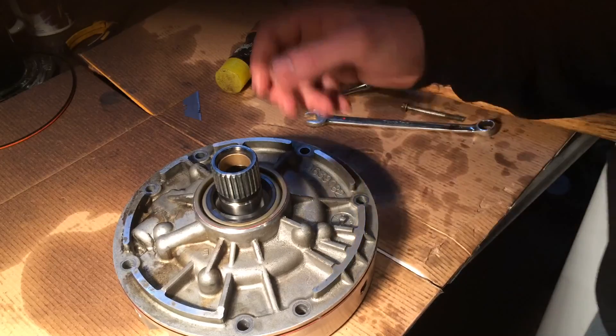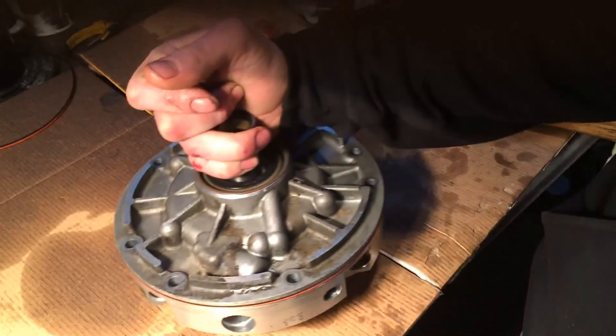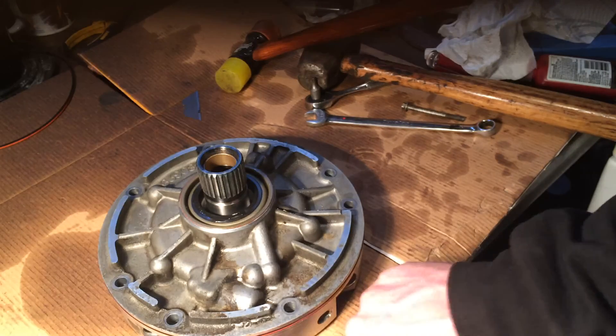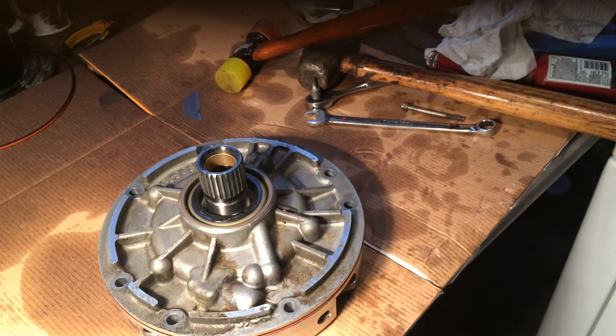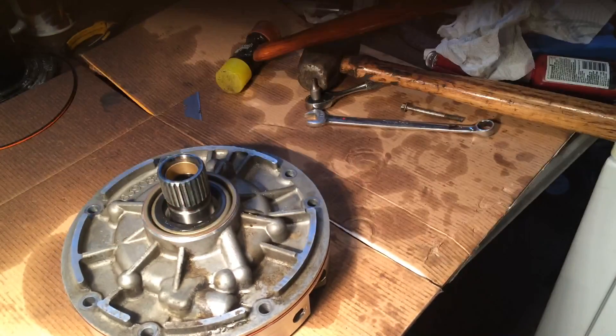One last thing — I'm not sure if it's these or the 700R4s, but I'll probably end up tearing apart my old one because I think there's a screen that's supposed to be up in here but isn't. I'll tear apart my other 200 to verify, and if it has one I'll just put it in this one. One last bit of information: these bolts here, I believe the torque spec is 18 foot-pounds. So just something to note. Anyway, that's about it for our pump — thanks for watching and leave a like if it's helped.